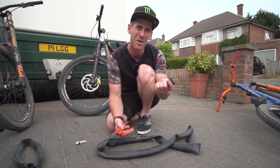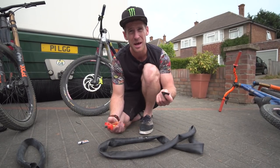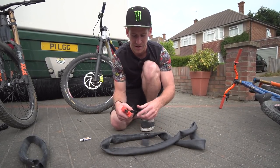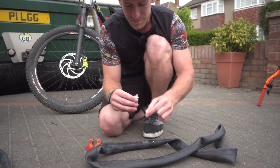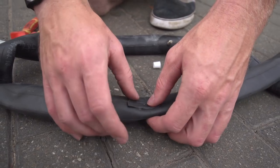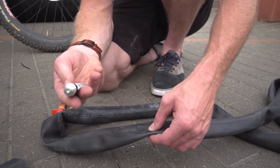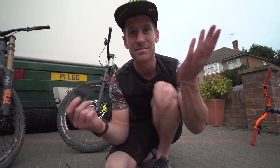This is number three. If you're one of those mountain bikers still using inner tubes, you're going to get a puncture. We've all got an inner tube repair kit but probably no patches in it because we always forget. So you can just use an old inner tube, cut it up like this, put the glue on like normal, cover where the hole is, and there you have your very own patch. All you need is some rubber cement off eBay and then you've got endless patches with an old inner tube.